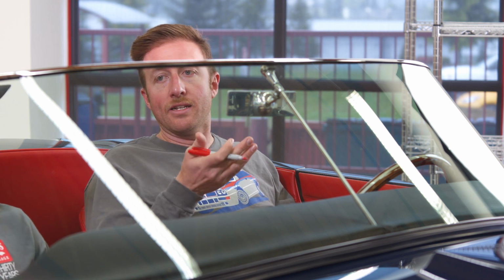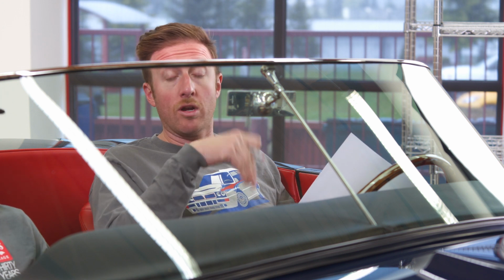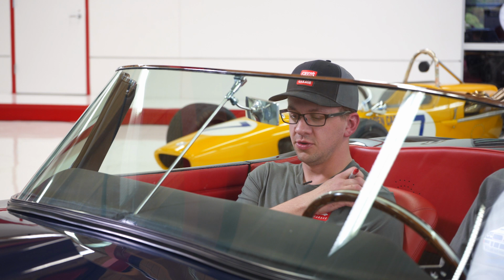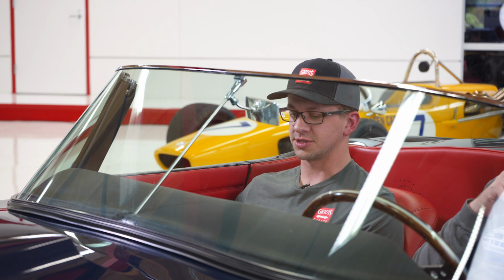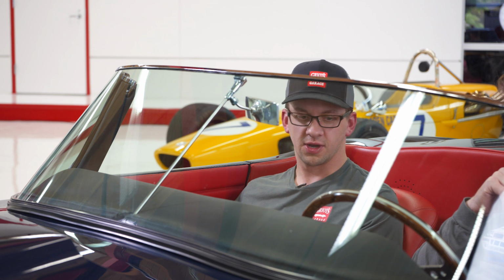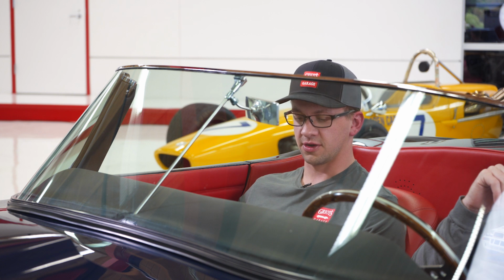So in that case, on mine, the ones that didn't do anything, but I just don't want to categorically state it because I have done appliances inside, and I think they're finished or treated differently than an outdoor stainless piece of equipment, and it did change the appearance of a refrigerator door I was doing. So just be careful, test an inconspicuous spot, but in terms of cleaning and protecting, you can do that without an abrasive. Yeah, I know some new appliances are coming with fingerprint resistant coatings and things. I just bought a new stainless garbage can, and it has a fingerprint resistant coating on it. Obviously, if you abrade that, it's probably going to go through it. So just keep that in mind if you have newer appliances that have any sort of factory coatings on them.